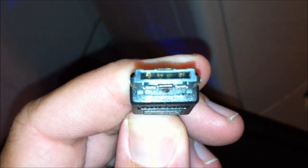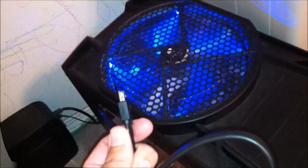Here's my E-SATA-P cable on the device end, which in this case I'm connecting to a full-size hard drive. I've got two different connectors here, all made into one. The longer connector here is for power, and the shorter width connector here is for data. On the other end, which plugs into the back of my main board, is the E-SATA-P main connector, and just like the illustration I showed you, it's keyed specifically for E-SATA-P ports. I'm going to go ahead and get this plugged in.